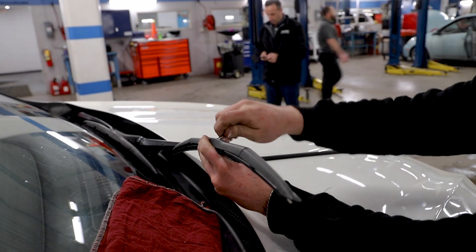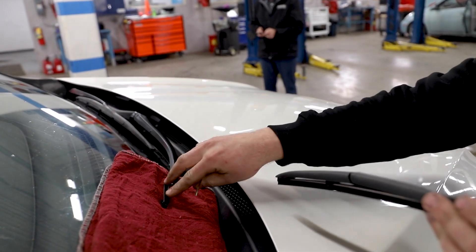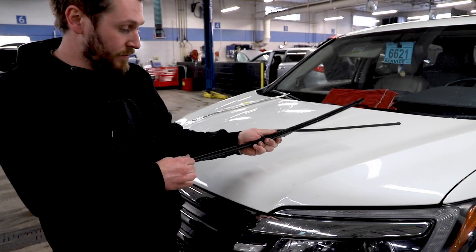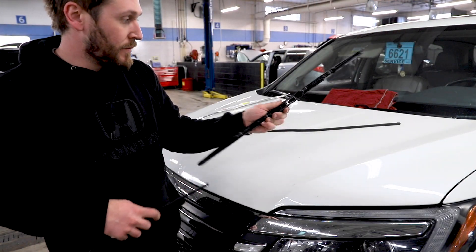At the front side of the blade is a recessed lever. Hold the lever open and then slide the wiper blade down until it detaches. Remove the old insert by grasping the insert tip, then pulling the insert out of the wiper blade.